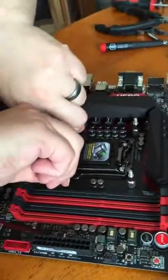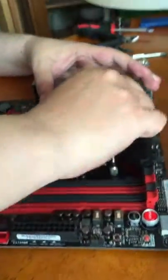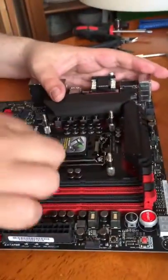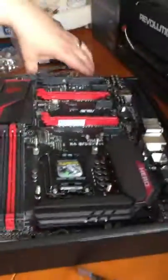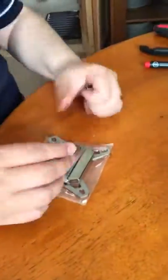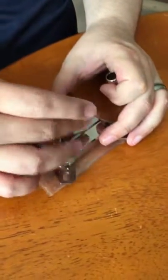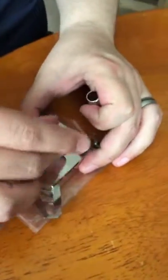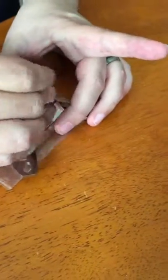Just give them a tighten, make sure that they're all down securely, and that's the motherboard now ready to accept the CPU block. Here's the Heat Killer CPU block — you'll notice on the right hand port there's a little black arrow. This is the in-feed for the water, so you need to make sure that your water flows in through on that side.